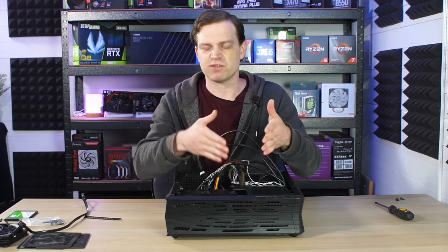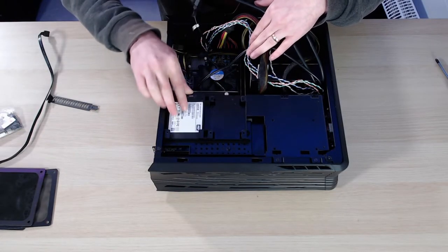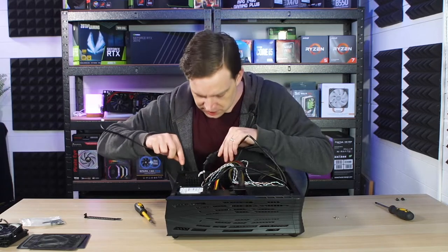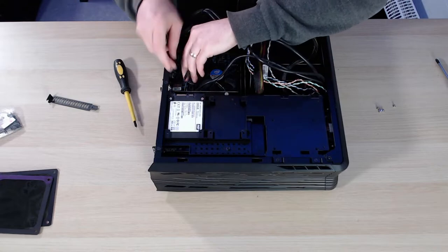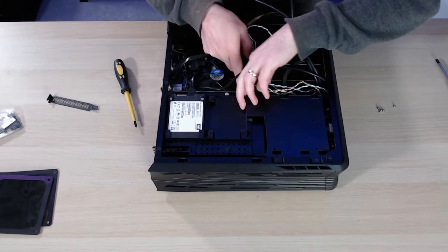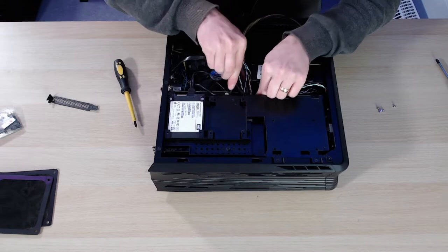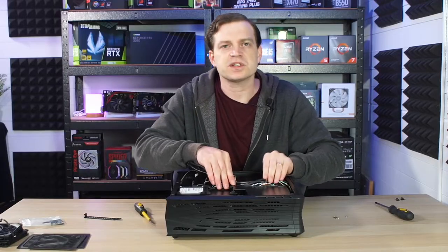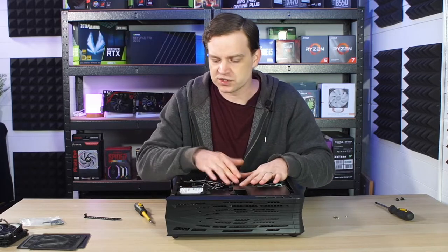Then we can look at installing it back into the base. As we put this down the graphics card extension bracket will clip into the motherboard, so we want to be careful and put the right pressure in the right place. All of that is now fitted and we're looking pretty good for the graphics card — we've still got a bunch of cabling to tuck away. We do need to fit the hard drive, which goes inside these slots; we'll put it in the back one, lift it up and screw it down. With the hard drive installed, we connect it up to the motherboard and bury the SATA cable, then tuck all the cables down and try to get them out of the way of the CPU cooler so it can actually breathe.